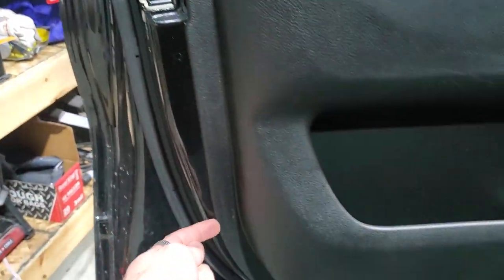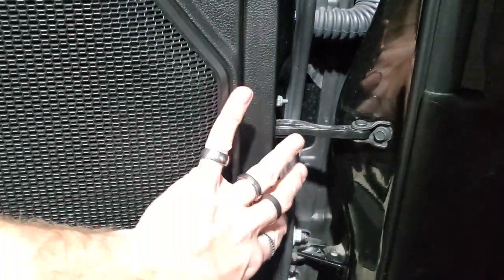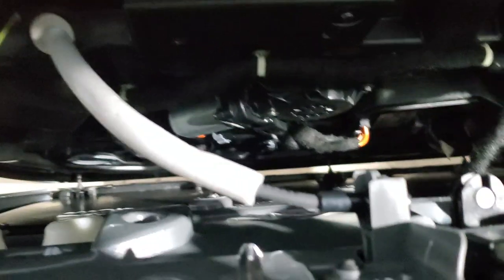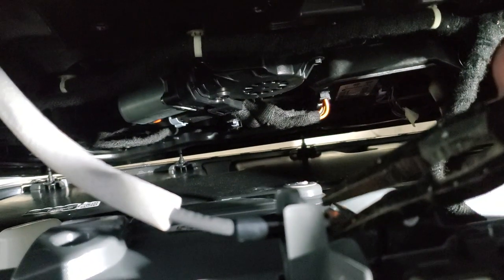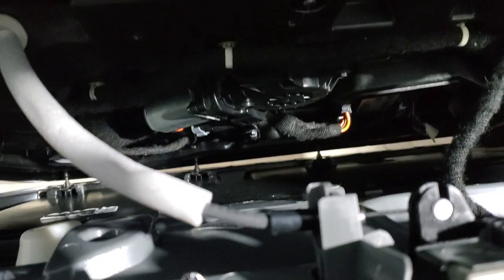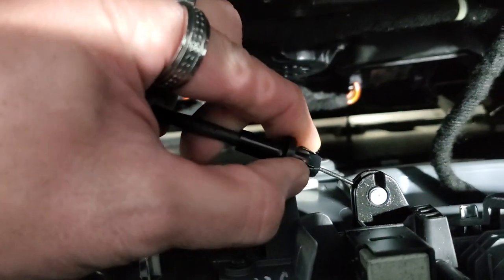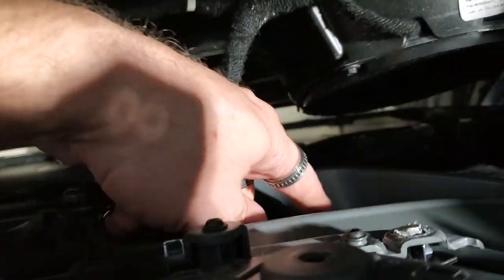Next, we're going to work around this edge. I would start inside this inner edge because there's a gap right here that you can pull on. These are really hard clips to pull, so be careful — especially if this is new, they're going to be real tough. Just be real careful you don't break everything. Then you're going to take your pliers, put them right here on the very tip, and squeeze the little prongs together to get this out. Once you get that out, remove this one harness right here — it unplugs. Then just pull this guy out, pressing with the needle nose to pull them through and out.